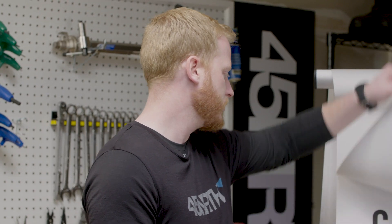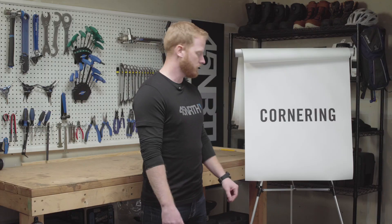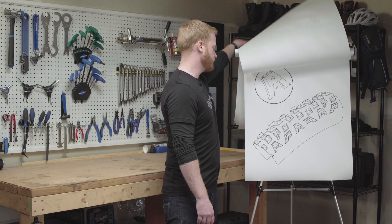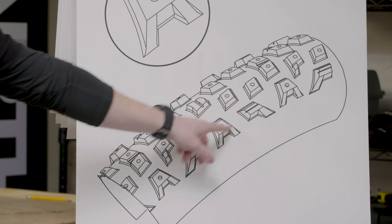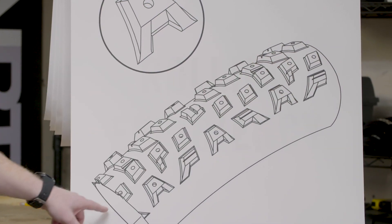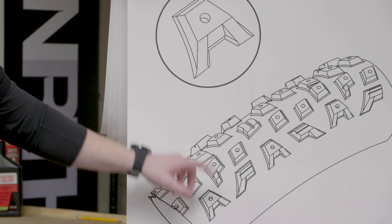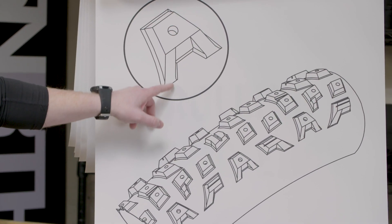Third, we're going to talk about cornering traction. This is your tire's ability to grip when you're rolling through a turn. Those are going to be the side lugs — they tend to be larger and more aggressive than the lugs down the center of the tread pattern. That's because you can have larger lugs on the side; they don't engage the ground too often, so they don't really affect straight-line performance as much. Additionally, because they are much larger, you'll notice this shape right here — we call that bracing. That's built into these so that the lug being taller doesn't buckle under strong cornering forces; it provides more structure.